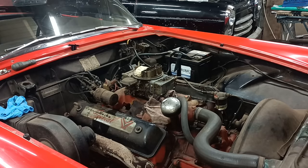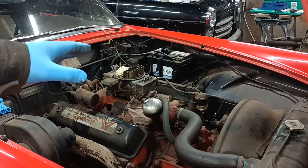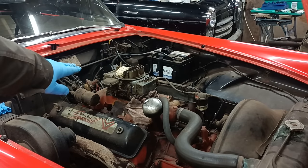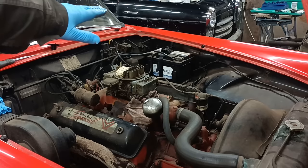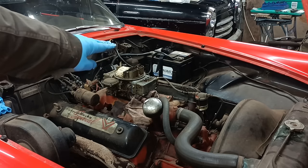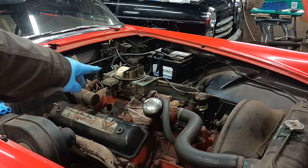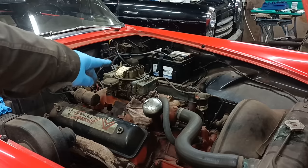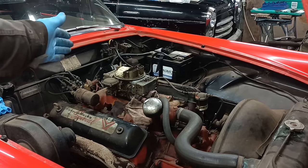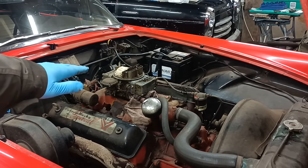Okay, that's good. I'll go and turn the ignition off and I'll be back. It stopped when the excess fuel level went from the float bowl. In other words, bear in mind I've got the two idle screws wound right in. If the level was right, it wouldn't run with the idle screws closed. It was only because the level was high that it's running without the idle circuit. It's running on fuel leakage somehow, you know, fuel's flowing over somehow.